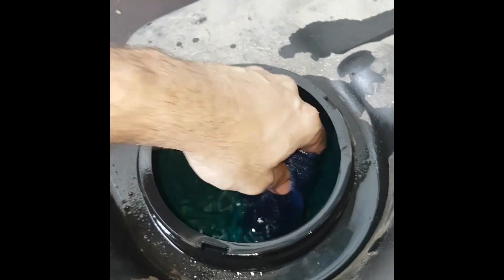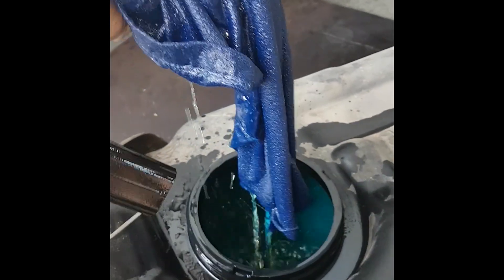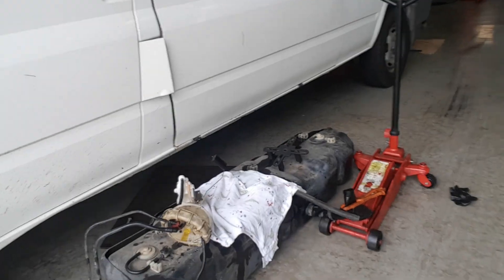Going fishing in the fuel tank — and there's the problem there. So even though it's coming up with a lot of high pressure type fault codes, it's always important to start with basic things, and a lot of the time it is going to be the low pressure side. Working back, we decided it had to be in the tank. The tank is on the floor here. It's never nice having to drop it out, but at least we had the diagnostics to say it was worth taking out. And lo and behold, we've got a rag in there. I'd say there must have been algae in there at some point, someone cleaned it — same old story — and they left one in there.